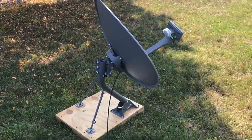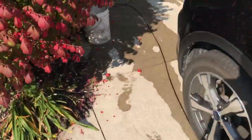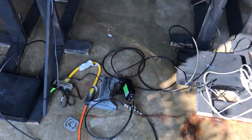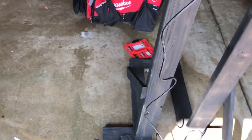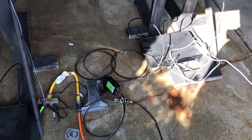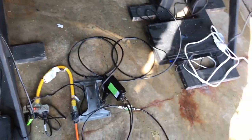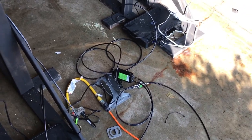Let me show you guys a tailgating setup — how to tailgate with DirecTV. You're gonna need a dish, coax run, and since I have two receivers, I'll need a splitter and a two-way power supply, just like a home installation except a little messier. I'm actually going to be mounting them in the back — I just did that to mock them up. Two TVs, and you can have them on one station or different games at the same time. So basically: TV, receiver, DirecTV satellite, and if it's a SWiM setup, you'll need a power supply.